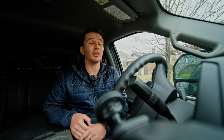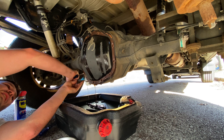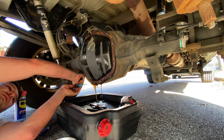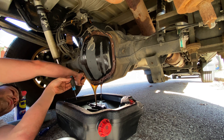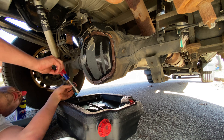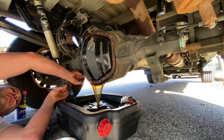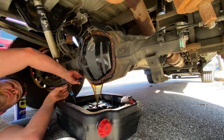So what are Ford's recommended service intervals? The Ford Motor Company recommends you change your differential oil every 100,000 miles. That is under what Ford considers normal operating conditions — driving the truck mostly unloaded, using it as a commuter rig, and not stressing it or loading it near the gross vehicle weight rating. For normal use, front and rear differentials across all models of axles, they say 100,000 miles.